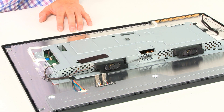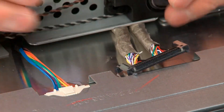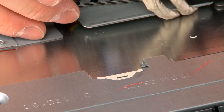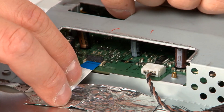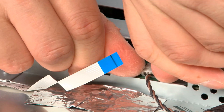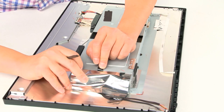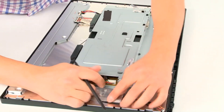What you want to do is disconnect two cables here and here. Disconnect this here, then disconnect this by wobbling it. Next, you want to disconnect your audio over here, and disconnect this right here. We have one more thing here on the other edge — you want to lift up this metal tape and disconnect this cable right here.